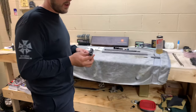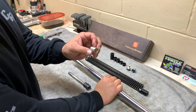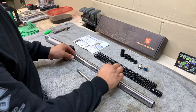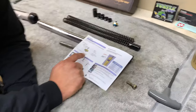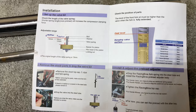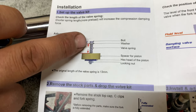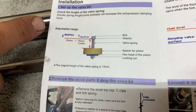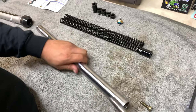We went upstairs and showed you how to modify the rod — now it's time for reassembly. The first thing you're going to want to do is put your rod center bushing back in the bottom of the tube. When you get your valves, they come set at 13 millimeters — they can go between 10 and 15 millimeters. That distance is between the washer and the top of the valve. The tighter you set it, the stiffer it's going to be; the looser, the softer. Now that the rod is modified, set the valve in on top — it fits real nice.